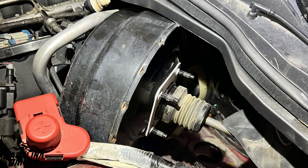There is a boot on the backside of the brake booster that's going to catch a little bit because it's got some ridges — just keep playing with it and pull it out. If you want to remove it completely, you'll either have to move your AC and brake lines way out of the way, pop the cowl off where your windshield wipers are, or do like I did and just pull it to the side enough so both of your hands can fit in there.